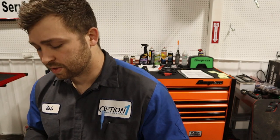I'm not even connected to the internet with this, and this does have a connection to the internet to look up known fixes for the engine codes that you might have. So if you had a P0420 code, which is a catalyst efficiency code bank 1, it'll tell you, 100 people changed the catalytic converter and it cured that code. Or there's 100 people who changed the bank 1 downstream sensor, and that cured the issue for that code. Or there's some people who changed the mass airflow sensor. It'll tell you, 100 people did this, 50 people did this, 20 people did this. So you can do your scoping and check for intake leaks, and there's lots of things you can do to try and diagnose that P0420 code. So it'll tell you that, which is very, very helpful. It helps you get the job done quick and really saves you some time.